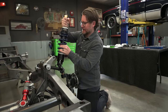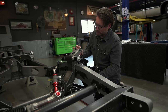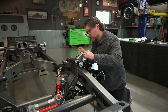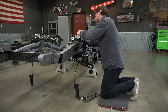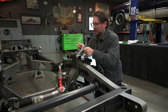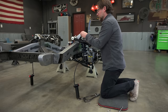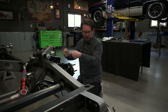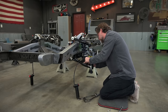I'm going to try to spin this adjuster around so he can get to the adjusters from the front side — it's tricky when you've got the upper control arm already in it. The cool thing about JRI is that when you order these, you tell them what the width is between all your mounts and they'll machine all the spacers so you don't have to do that. If your upper on the fronts has an inch and a quarter width, they just put in the stainless spacers. Same thing with the lowers — we told them the lower control arms were built with a trunnion mount, how far the bolts are apart, what size bolts you're using — and it's in the shock already when it comes. Can't get easier than that.